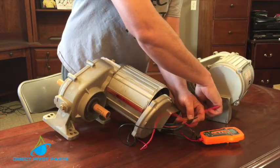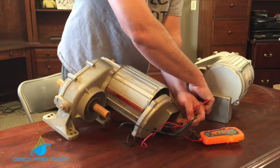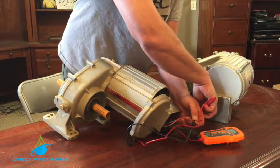Test each line to ground — none of these will beep because this is good. If you do have any of these beep to your ground wire, your stator has a dead short. It is bad.